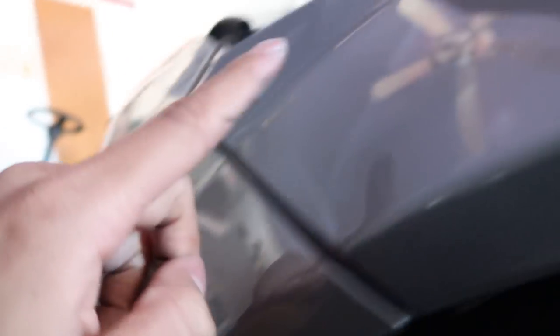Once you take those three pins out, pull it back. Deep in here, between your bumper and fender, there are two bolts facing vertical. It's kind of dark — you just can't really see them. But there are two bolts right there, and you take those two off.